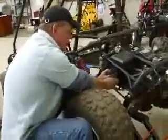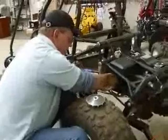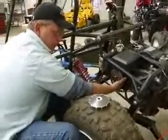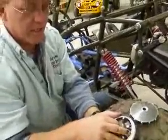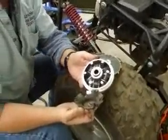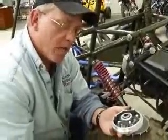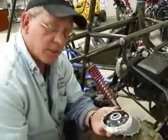Get that nut off, slide your variator fan off, take your drive belt off and lay it to the side. Then slide the boss pin and the whole variator out — put your fingers back behind there because you want to hold it together as you pull it out. You'll see the backing plate and the rollers inside. We're going to weigh these rollers to see what weight we've got, and drop one or two grams to give a little more low-end torque without sacrificing the top end.